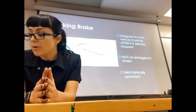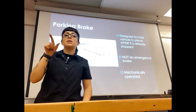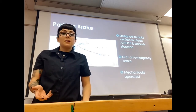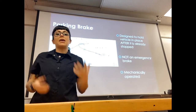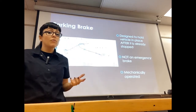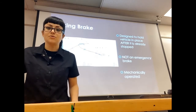The parking brake can be electromechanically operated — if you've got a button to engage it, it's going to be electronically operated but still mechanical in nature, while all other designs are a straight mechanical lever or pedal. It will require some adjustment over time because those cables have a tendency to stretch.